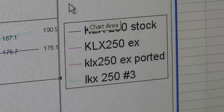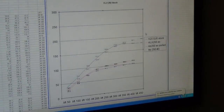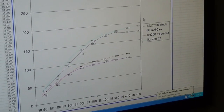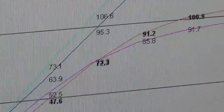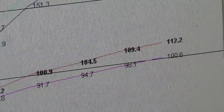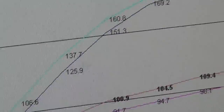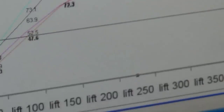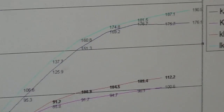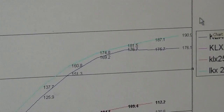It's basically a dynamometer for your cylinder head, but instead of showing horsepower and torque, it shows airflow. This display shows the actual changes as you go. You can look at that graph — the bottom graph, the purple graph, is the base flow of your intake at various lifts, and it shows how much airflow is flowing through the cylinder head at a depression of 28 inches of water. You can see gains all the way across the board — there's nowhere on the intake graph that we've lost any flow — so you should see a decent gain from that cylinder head.